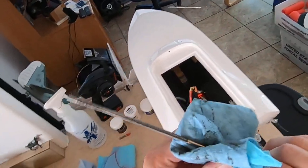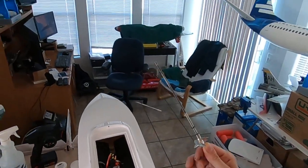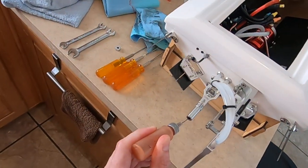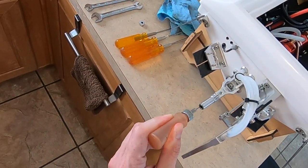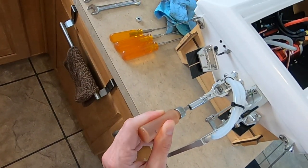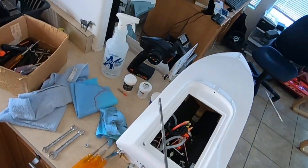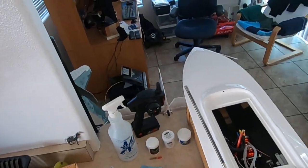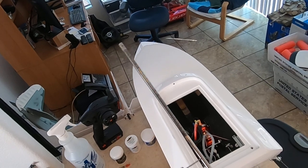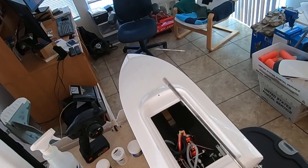It's pretty clean. I'm going to show you something I like to do — you don't have to do it, but I like to put some oil right down here in the strut bushings. This is just a bearing oil for electric motors. Put a good amount in there. I'm going to put grease in this area too, but I'll still put just a little coating of this bearing oil on this area here.